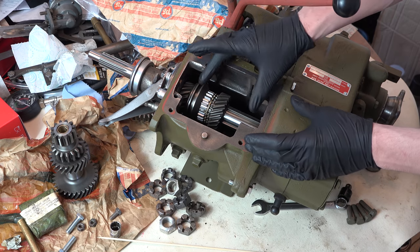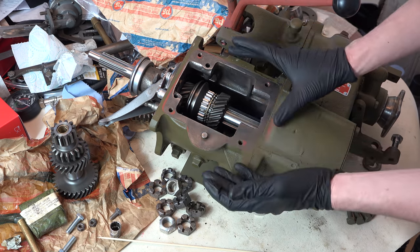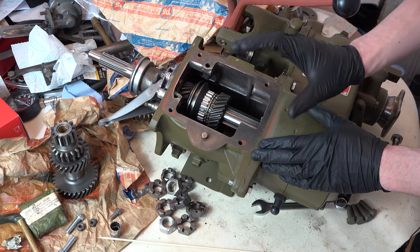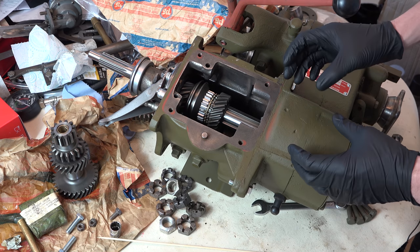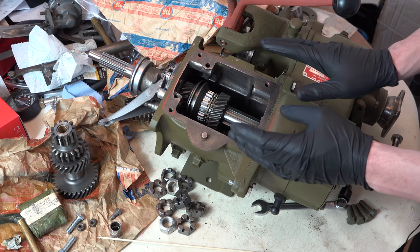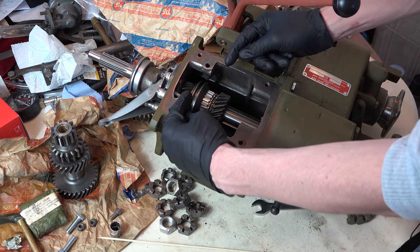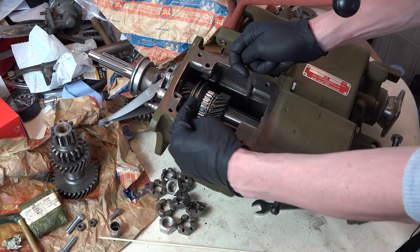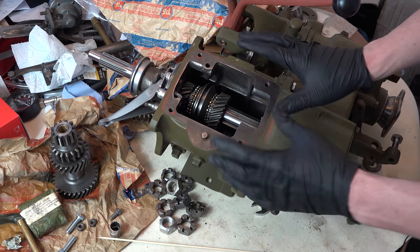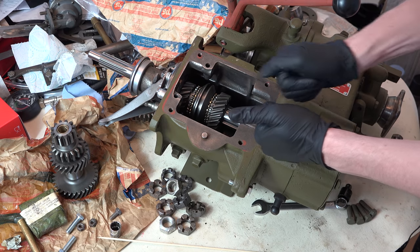What I'm going to do now is disassemble the top portion, get the cluster gear underneath ready - which is a bit of a bear to do - then reassemble it with everything in it, re-bolt it back together without the gasketing, put the tower on and make sure it all works when complete. Then take it apart and start gasketing up for the final time. You've got to check it multiple times because things affect each other - the shifter forks and detents set how far the fork goes backwards and forwards, which can affect things. So we'll set it all together, try it, and then hopefully do the final build so we can put it in the Jeep.